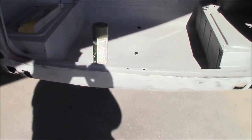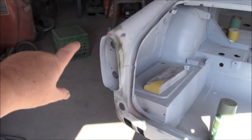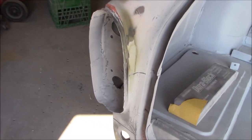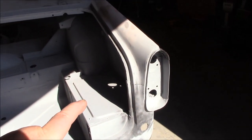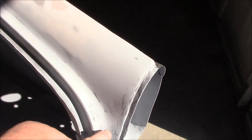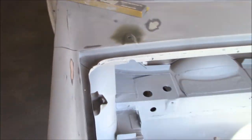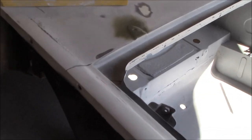Most of the rest of the car has been done - there are a few touch-ups needed like the corners of the rear valence. We're going to clean up these areas; I've got a little bit of runs in this area in the primer. We're going to reprime this area. There's a little bit of a sanding scratch mark I need to fix before we get into another coat - maybe two coats - of primer.